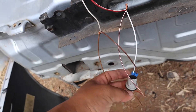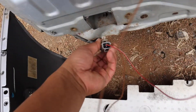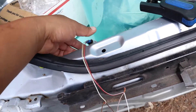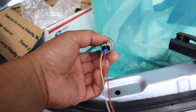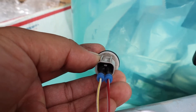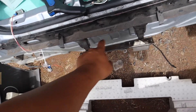Here is one bulb and here is the other bulb. If anybody out there is wondering which wire plugs into what — I kind of actually guessed. Looking at the plug on the harness, I have power on the left and ground on the right. I wanted to keep it simple to look at, so I put power on the right part and ground on the left. You can look at the tabs — that way it's a lot easier to see how I ran it. And the lights are on — sick!